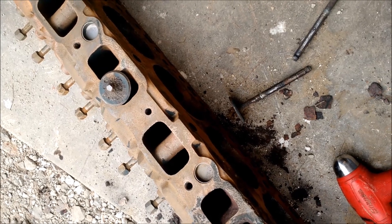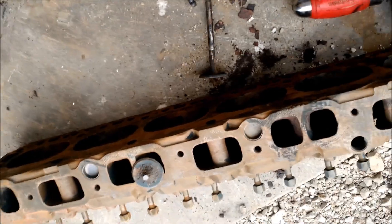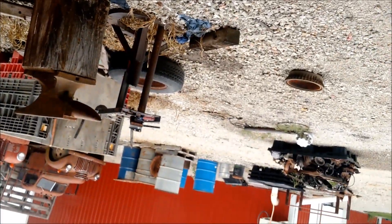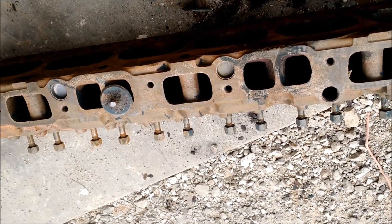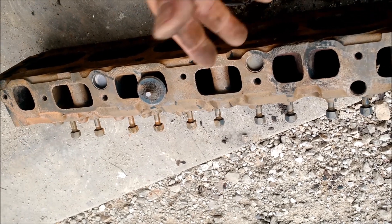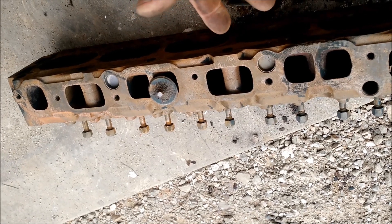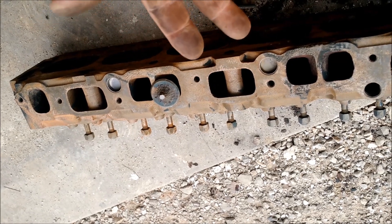Also, if I have a block that's seized up, I will bake that block to get the oil out of it, then throw it in the molasses barrel — you can see the molasses barrels over there. I'll come back in a week and those pistons will beat out of the cylinder bores. Whereas if you try to do that before, when the rust is really present, you'll break the block. But if you wait until after the molasses works, the pistons will slide out — not super easy because they've had a lot of junk around them, but they will slide out.